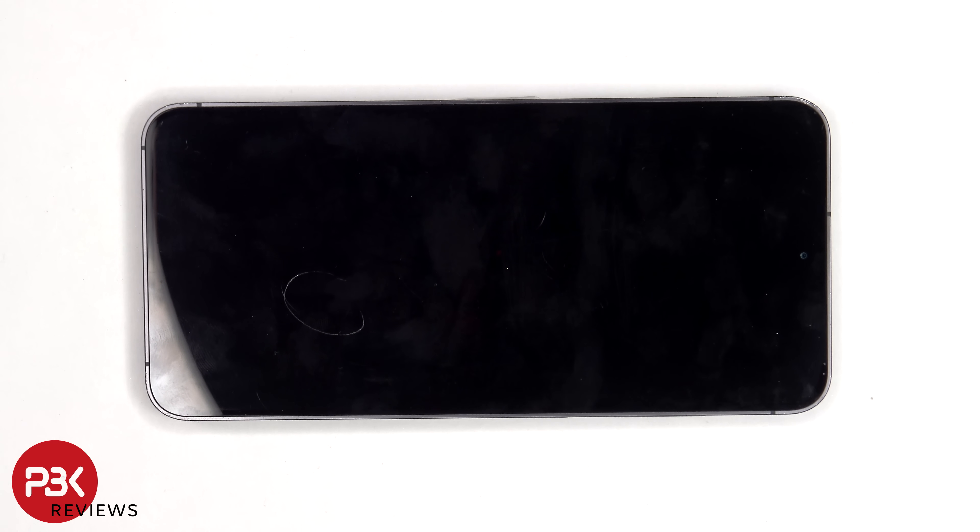Most screen replacements will come with the frame assembly pre-attached. But if you need to replace the screen by itself, once you take apart the back of the phone and disconnect the cable for the screen, you'd have to heat up the front of the phone to loosen up the adhesive underneath and pry the screen off from the frame. With these newer phones, since the bezel is very thin, there's almost no room to apply adhesive to the glass, so they apply adhesive behind the screen itself and adhere it to the frame. That makes prying off a working screen almost impossible to save, since the screens are very fragile — no matter how much heat you apply and how careful you are, you're almost guaranteed to damage the screen when prying it off. For most cases, people replacing the screen are replacing a broken or damaged screen, so there is no worry about damaging it at that point.